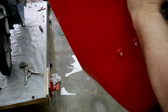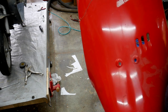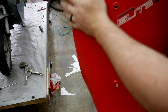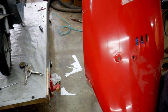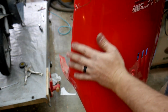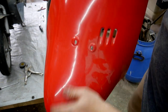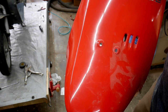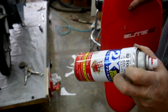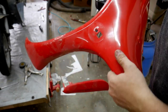I have to address the tabs after I make the front of this look pretty. I have some sandpaper, I'm going to tape off this sticker to try to save it, and then sand down where I did the body work. Then I have some bondo and I'm going to try to lightly bondo the cracks and make them go away. Once I feel like I've done a good enough job, I'm going to repaint this whole fairing using Rust-Oleum Apple Red.